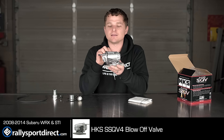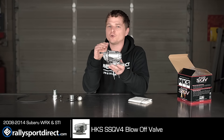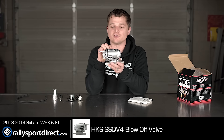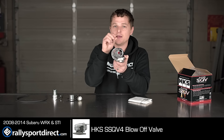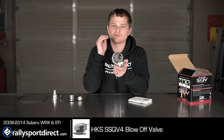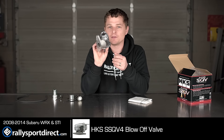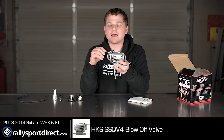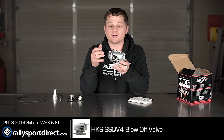Another thing that makes it unique is it utilizes basically two types of ports. So when you first let off the gas and a normal valve would just go whoosh, this one opens up a smaller port right dead center in there first, and then literally a millisecond or so after, it pulls the whole port back. So you kind of get that trip-trip-trip-trip-trip sound. That's where the unique sound that has kind of become famous came from — this particular valve. Because it has that unique design, it creates a very unique sound, and it's not only built for the sound, it's mainly built for function. You just happen to get a very cool sound as a byproduct of that.